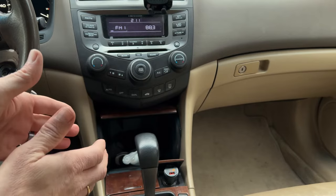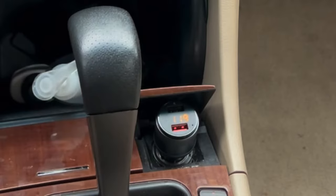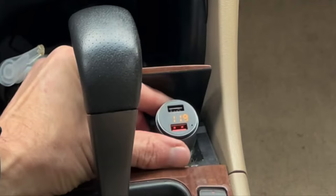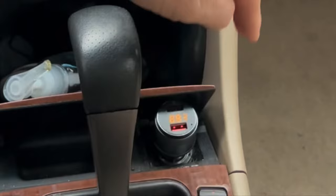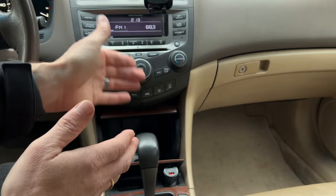Mine went quiet because I already had this set up, and it made a noise saying that the Bluetooth is pairing. One cool thing — there is a number that says 11.9 — what it does is show you the voltage of your battery the first few seconds that you plug it in. That's a handy feature to know if your battery is properly charged. Once you have it tuned to the right radio station, press and hold that call button and you'll see 88.3 flashing. Adjust that with the arrows — there's 88.1, I want to get it to 88.3 — and that matches up with my radio. Now I don't hear any background noise, which is good. That's step one: get them synced between the radio and the actual device.